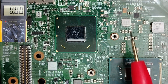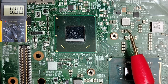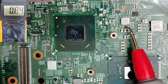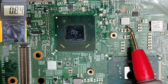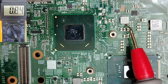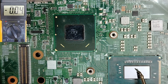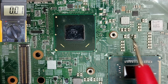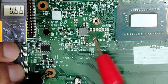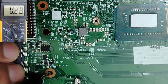For the CPU specifically, we should get a voltage of about 0.7 to 1.2V — it could be around 0.9V. Checking now, we get 0.84V. This is the VCCP or VCC for the CPU, and 0.84V is good, so it is not a short circuit. Without removing the CPU, this is the method: check the voltage in the inductor that shows a low reading in continuity mode.